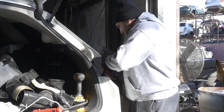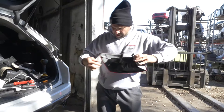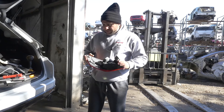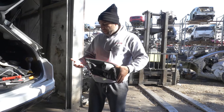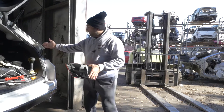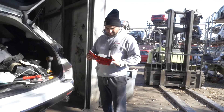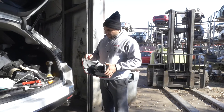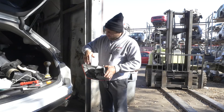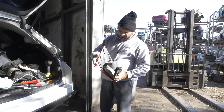Let me show you what the holdup is. On most cars these two clips slide into the quarter panel, but on this TSX wagon there are clips that pop out this way. If you get a plastic panel popper you can stick it in here and pry against the quarter panel to pull it out. I was afraid of doing that and damaging the paint, so I went ahead and sprayed some WD-40 in there, got them loosened up, and stuck my panel popper through here pressed up against the inside to pop it out. The taillight came out without being broken, and then go ahead and unplug the taillight.